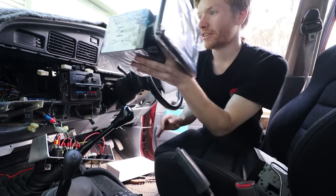My whole idea behind this was to have stuff running on the secondary battery — to be able to play music at camp off the secondary battery. So what this allows you to do is turn off the car, which obviously kills your stereo and UHF. But I've got no keys, and then you can flick this button here and it powers everything on. That powers up my subwoofer and my head unit off the second battery, so I'm not draining my main battery. I can be out at camp and still have my tunes playing. Another switch powers the UHF on the second battery. And there's one that's top secret — you'll know about that one in a couple of weeks.